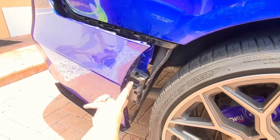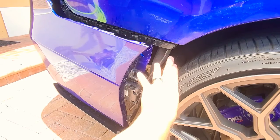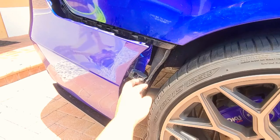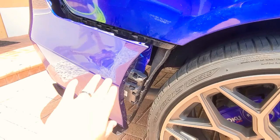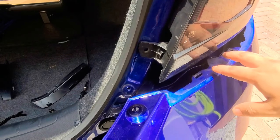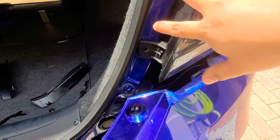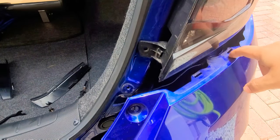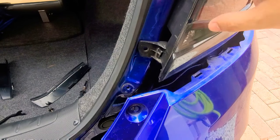There are going to be three screws: two located here, and then one that's in the upper area — hard to see on camera but it's located right here. It's a Phillips screwdriver, as well as the two that are here on the side of the bumper which releases it off of the liner and releases the bumper. On this side you can snap off — as you can see, there are clips here. It just snaps off with your hand, you just need to pull and snap off. There are also tabs located right below the taillight. To facilitate the process, I removed the two screws holding the taillamp, got my hand in to remove those tabs, which makes it much easier to remove. You don't need to remove the housing, but you can pull it — it makes it much easier.